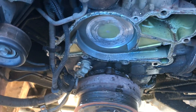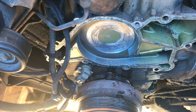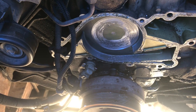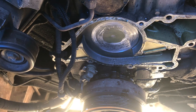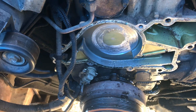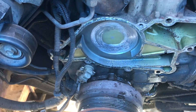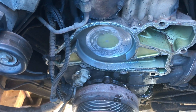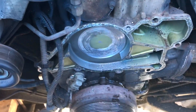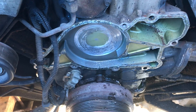It's all out for tonight. I'm really not sure what to do about cleaning all the little bits of aluminum and garbage out of there — other than just take a garden hose and flush it out. There's probably more of it down inside the bottom of the engine and in the radiator too. So probably just get this all put back together, run the engine for a little while, and then do another radiator flush. We at least got it tore apart — that was my goal for this evening. I'll come out later and try to start bolting stuff back on.